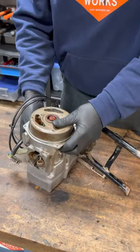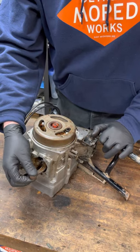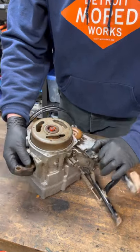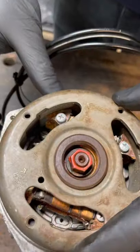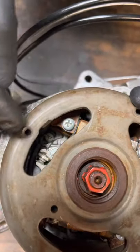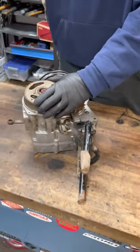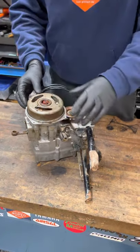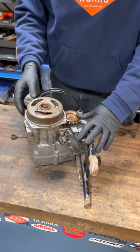First thing I'm going to do is just check to see if the points even open. I'm going to be looking for top dead center, which when you pull the crankshaft out all the way is going to be the top. And then you can see in here your contact points — you can see them opening and closing there. That means that they do open and close. They're actually not too dirty when you look in there; you probably want to file them before running them. But I'm just checking to see if it works.